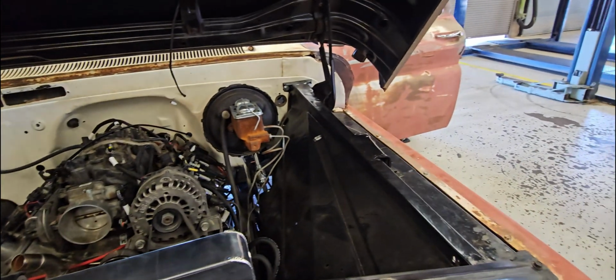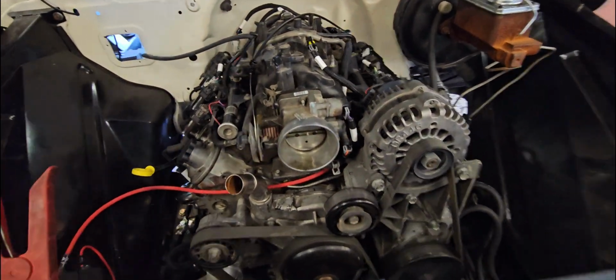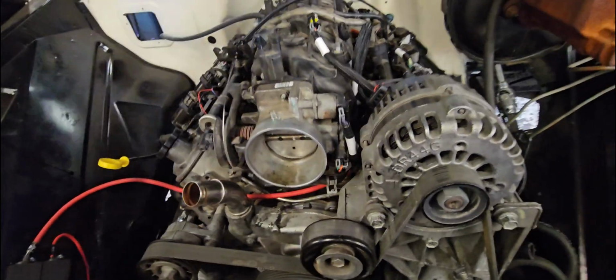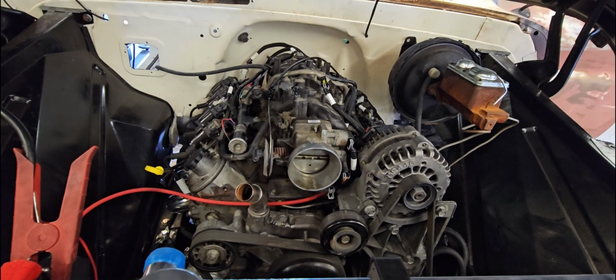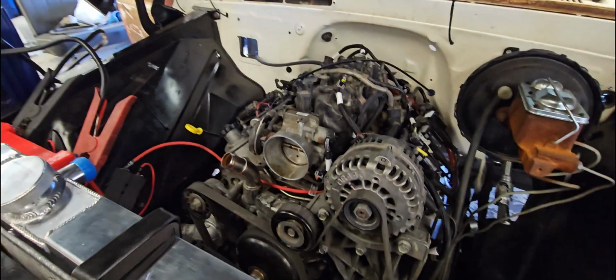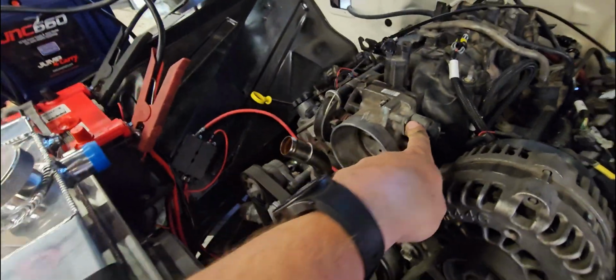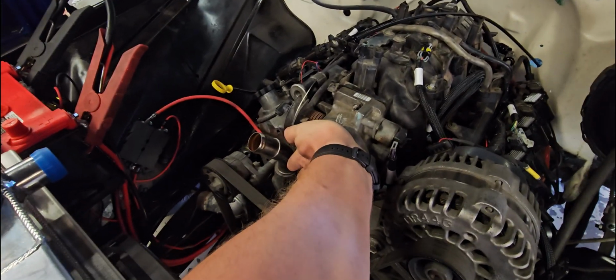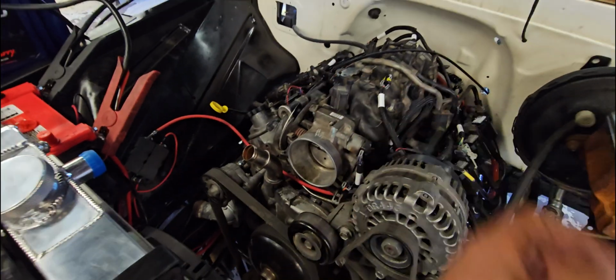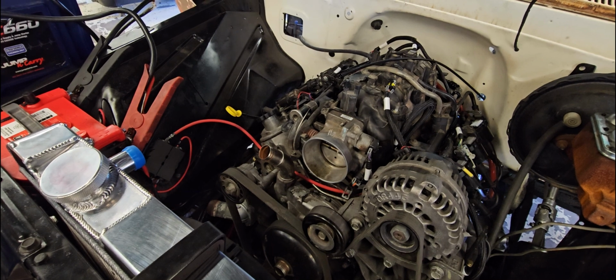Clean the idle air control valve. Take it out and clean it. I wonder if it's stuck at 90% and the AC is not pulling for 90%. I wonder if it's stuck. Okay, they're Torx. Well, dude, I cover it completely and it creates a crazy vacuum and then it starts. It feels like it's going to suck my hand in.